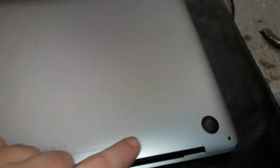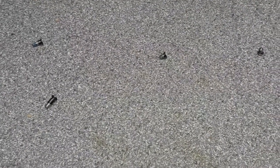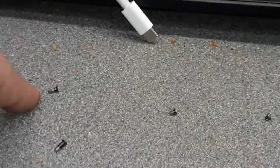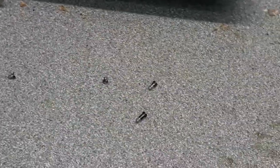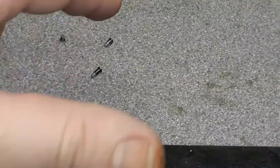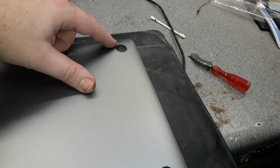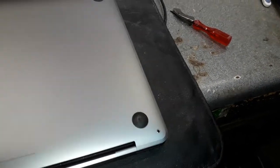When you take the screws out of this laptop, pay attention to the size of the screws. You can see there are large screws on top, and on the corners at the bottom you have two slightly smaller ones, and in the middle two small ones. Be careful when you put the screws back so you don't put a big one in the wrong place. This one is the small one and that one is the large one - be careful.